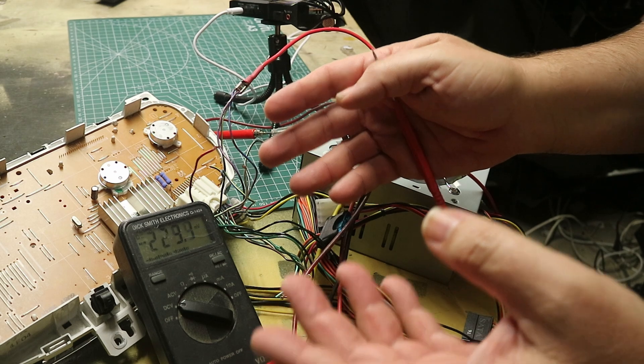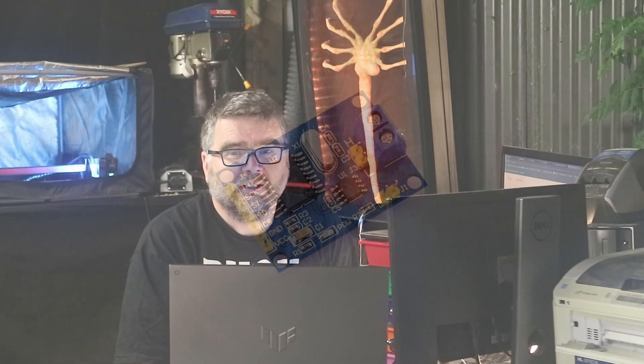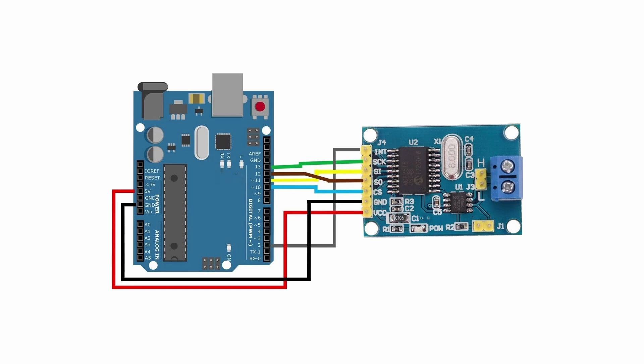Now we have to hook it up to our computer to see if we can get any data. Once we've got CANBUS high and low sorted, we need to connect it to our computer to start talking. You can't just plug it directly into Arduino because the frequencies on CANBUS are quite precise and need perfect timing. So you get these little modules called MCP2515 — they're very cheap and easily available. It acts as a go-between for our Arduino and the CANBUS network. On one end it has H and L for CANBUS high and low, and the rest is an SPI connection to Arduino. There are pre-built libraries to communicate across the network, but there's a lot of fiddling involved. However, there's one called CAN Commando by Matthew Kirkonich that does everything you need to get to this point and start testing.